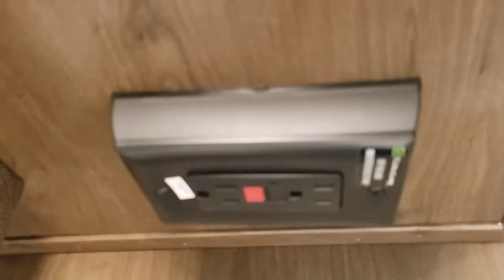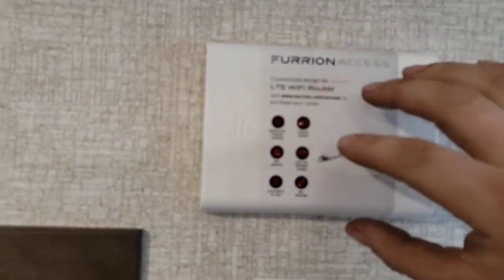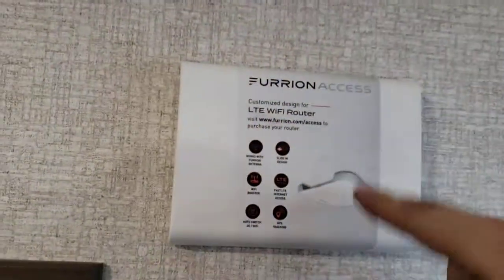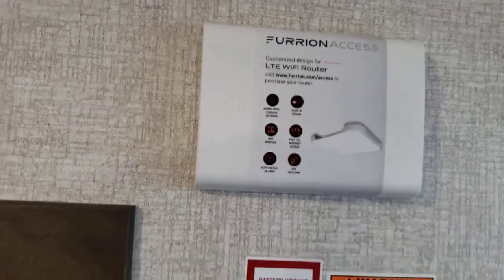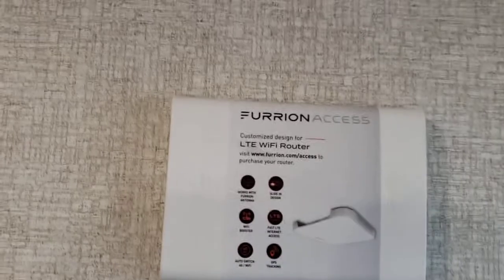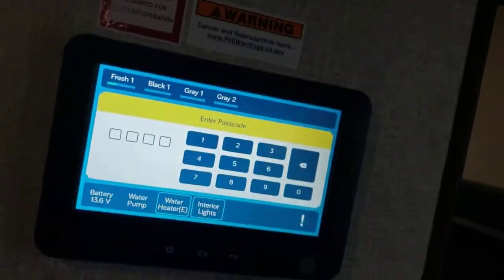You have more USB ports and more GFCI-protected outlets. There's one GFCI outlet you actually reset on the outlet itself — it's the only one on its own GFCI; the rest you reset in the bathroom. You're also partially set up for the Furrion Wi-Fi access point — you order the part from the Furrion website, it replaces the existing piece and slides in here. Then you pay Furrion a monthly bill for Wi-Fi access — about 60 dollars a month for 10 gigabytes. That's nice to have Wi-Fi rather than using your phone data.